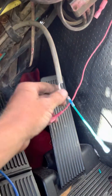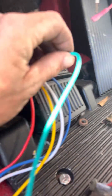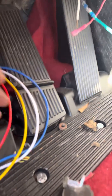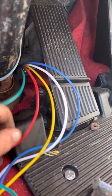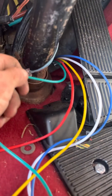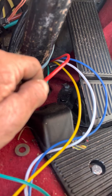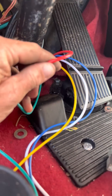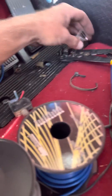It's only getting power when your clutch is at the home position. When your clutch is at home position it's going to send power back through to this wire, and this wire on my harness ties into the green wire. This goes to your fuel pump switch — you have a power in and a power out, the same as this switch. So this goes into one side of the fuel pump switch, and this is the return wire coming out of the other side.